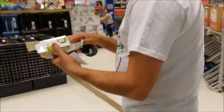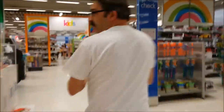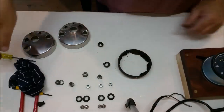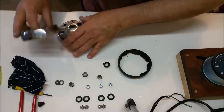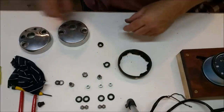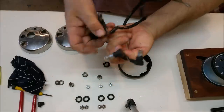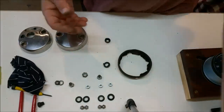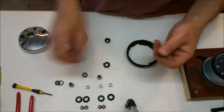What we're doing is getting a tire tube to fix our speedo. We've got the shells that go on the back of them - they're not in bad nick. Certainly a little bit of fine steel wool to fix those up. One of them was covered in overspray, which is easy - we can take it off. There are grommets that are knackered that go through here for the lighting and the lighting looms. I've got to get four new bulbs for them. The other thing is the grommet that goes in for the trip meter is buggered - even if I glue this together it's just not going to seal. So I'm just going to use a regular grommet and pop a hole through with a wad punch.